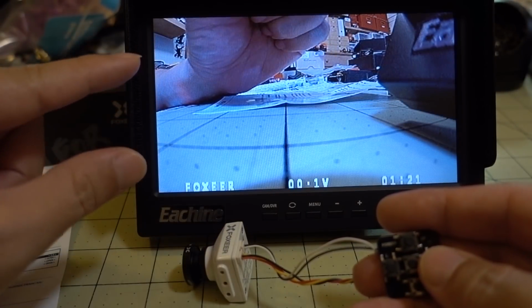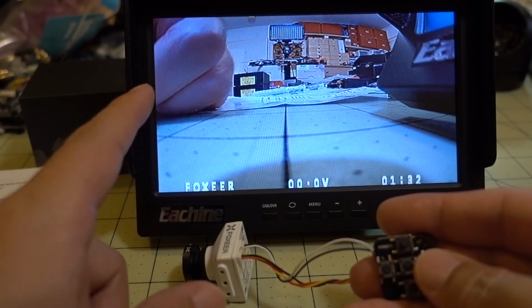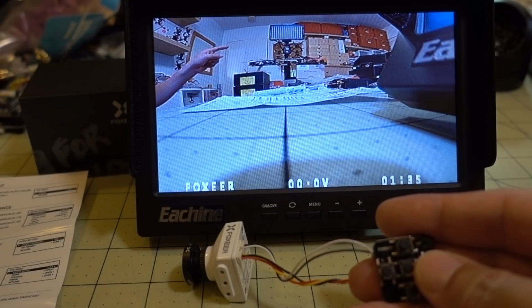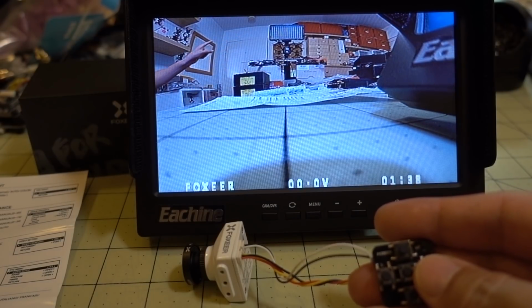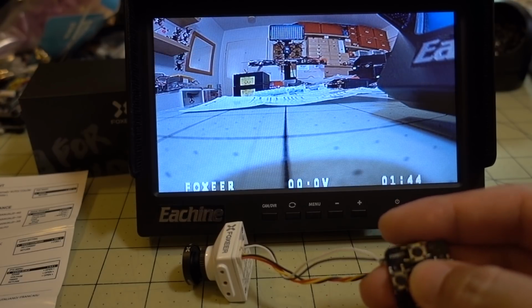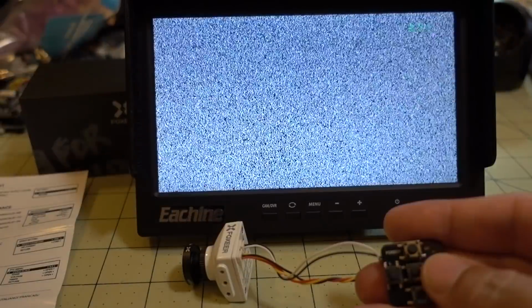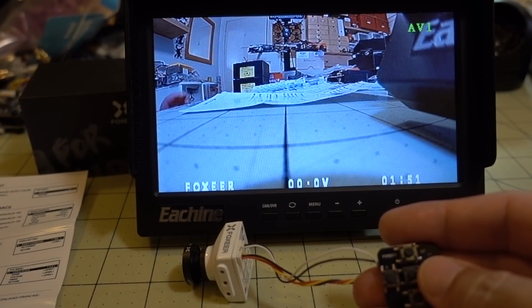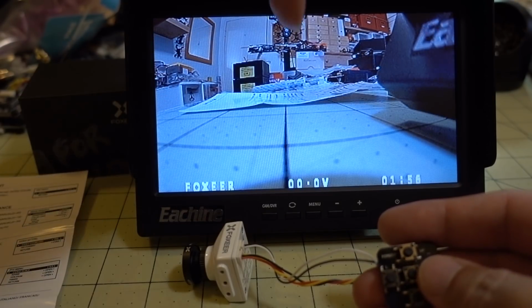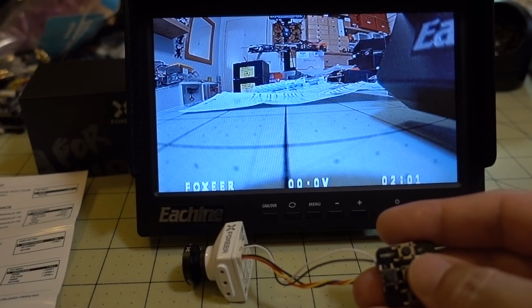and it looks like it zooms in on the 16:9. Yeah, it does look like the field of view, the image, kind of zooms in over in this direction over here behind me. I think that this zooms in right in this area. Yeah, so it looks like it's cropping the top and the bottom of the image. So the top here and the bottom gets cropped, and I think this is a 4:3 sensor. So if you go 16:9, you're going to get a cropped image on the top and the bottom.